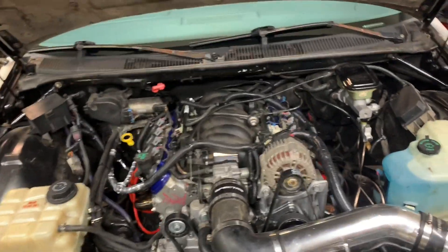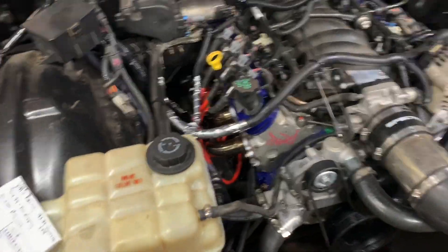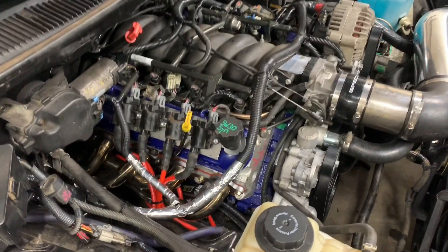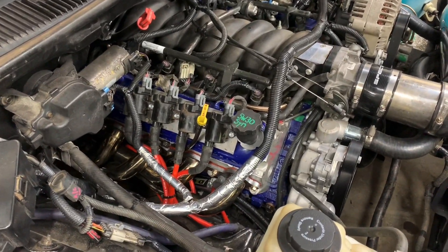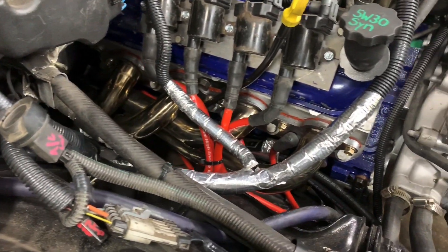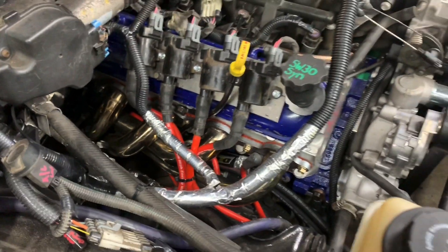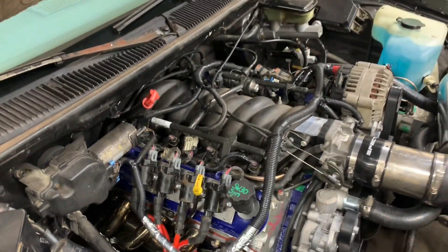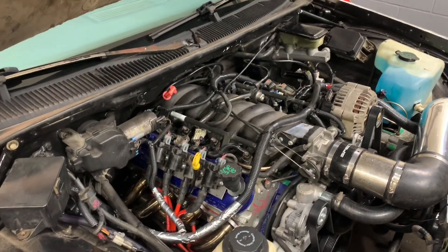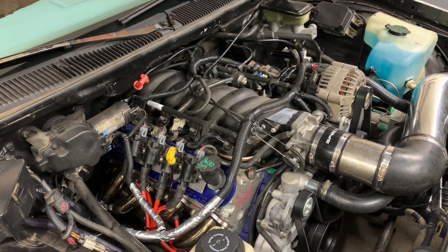Just a little update — wanted to give you guys another video and show you how it's coming along. With everybody being stuck in the house right now, it's pretty easy to get some work done. I pulled those headers back off and put the gaskets on, new manifold bolts, and I always put a little high heat silicone on there too. Until the next one, I'm going to give you guys another drive video — maybe some donuts, a burnout video. So like the video, subscribe, and wait for more. All right guys, talk to you later.